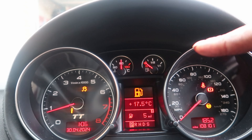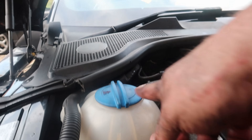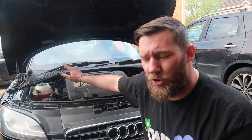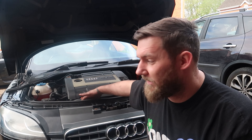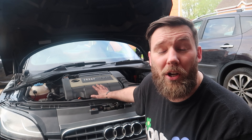The car's up to operating temperature. The heaters are blowing warm, which is a good sign. Coolant level is sitting steady with the cap back on so the system is now pressurised. I've had the car running for the best part of half an hour at temperature — coolant cap on — and the temperature isn't going above 90. The fans kick in and it stays at the 90 mark. Heat inside is also nice and warm. The only true test now is a road test to see if it stays at temperature while moving.